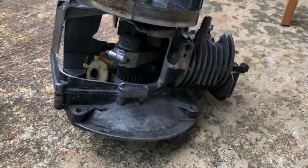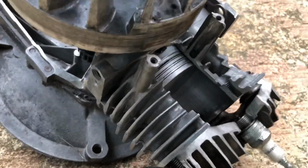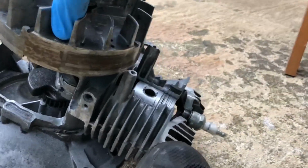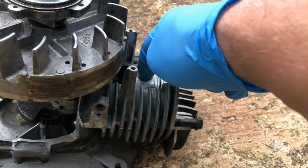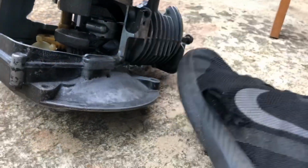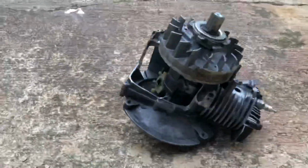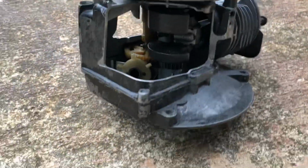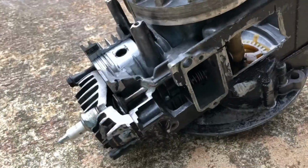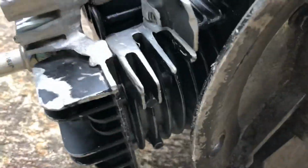It's got what's called a crankshaft, which goes around, and it's powered by this piston, which goes up and down. And it's kind of like riding a bike. Think of this joint right here as your knee, and this connecting rod as your leg, and this part of the crankshaft is the pedal. It takes combustion, basically an explosion of fuel vapor and air, to push it down. And it's got two valves, one to let air and fuel in, and one to let exhaust out.